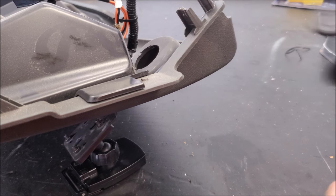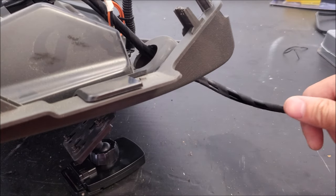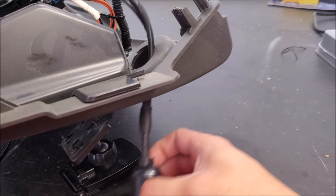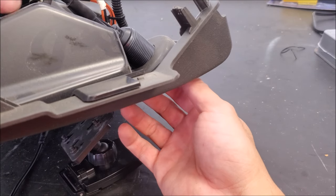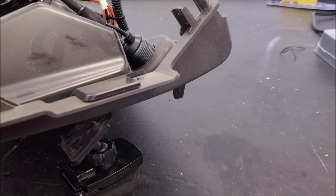Now the best way to do this is to buy a product designed to go into these ports. We bought one that's designed for this exact diameter. I've done a bunch of installs using more universal stuff where you can hot glue the back end — it really depends on the application. I have room over here so I'm not modifying this at all; I have lots of clearance in spite of how large this looks. You see it just goes in there like so, and then you're going to look on the other side, make sure it's straight, and then we can go ahead and put on this jam nut to hold it in place.